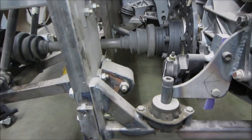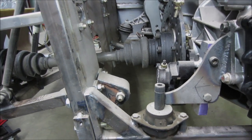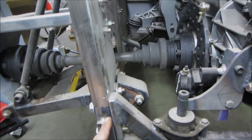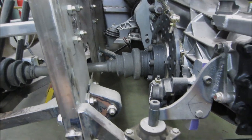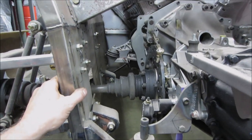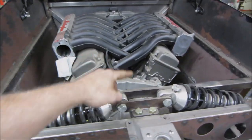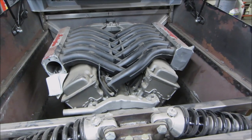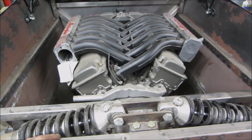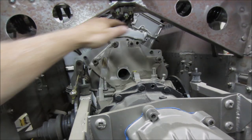I say we probably go, we'll disconnect the drive shaft, the CV joints, and I'm gonna bolt the cage here. We got to prop the engine too, because it's one side of the mount, and the other mount there will be nothing holding it. So maybe we'll put a board across the top. Not sure of that. Either that or a jack and a block from the bottom. We should have enough room to clear all this. Yeah, we got plenty of room here.